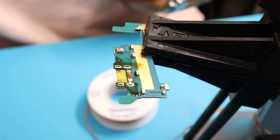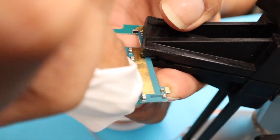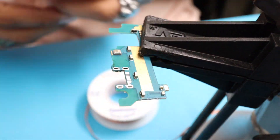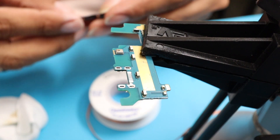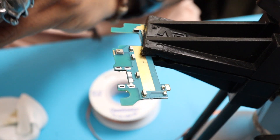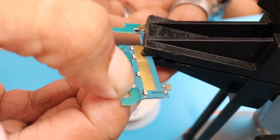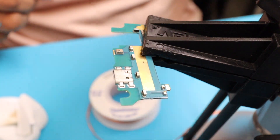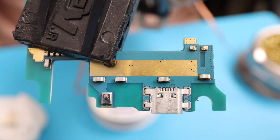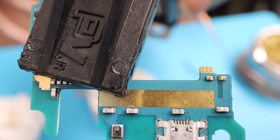I'm going to go ahead and clean this area with 99% alcohol. We're going to try to fit our new charging port in there — the area is all clean. We have successfully cleaned this area. Our new charging port sits in place really, really nice. After doing that procedure, our new charging port sits in place perfectly. I'm going to do the next process under the microscope.